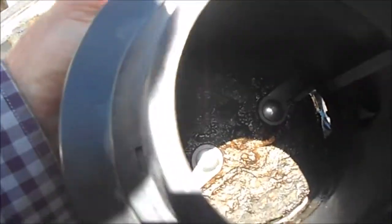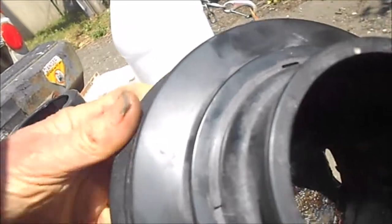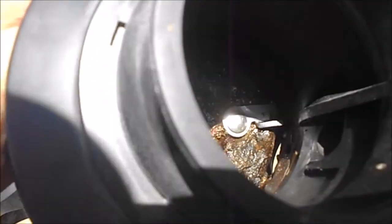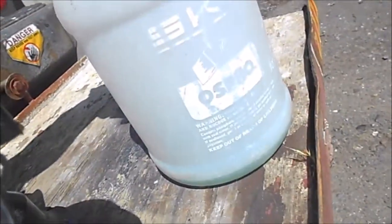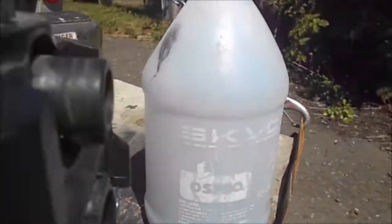The chopper plate is pretty well rusted. This would probably be a really good machine if they had used a stainless steel chopper disc, but what's happened is the little stainless steel arms - the dogs or whatever you want to call them - have rusted in place, so they're not chopping the food up the way they should. What I did is take a screwdriver, dip a rag in Ospho - Skyco Ospho - and run it around inside there. I put a couple drops of oil in it to try and loosen up those little dogs, then treat it and spray paint it.